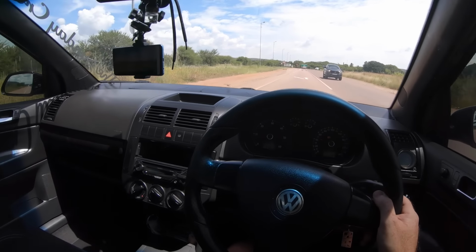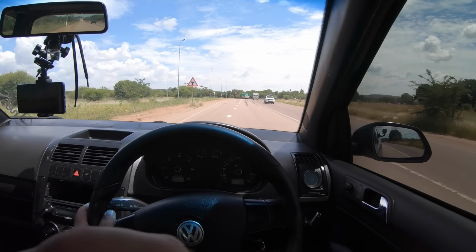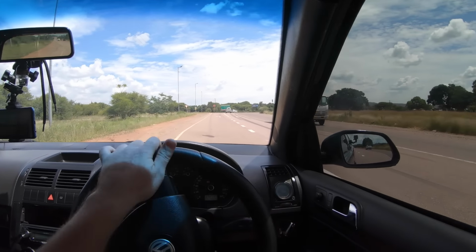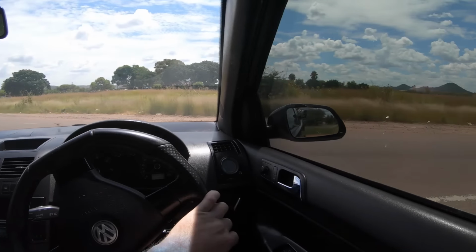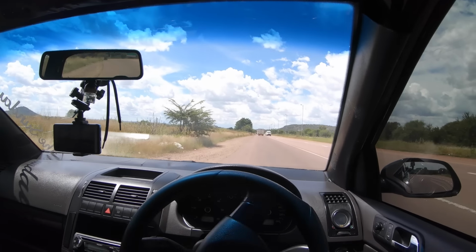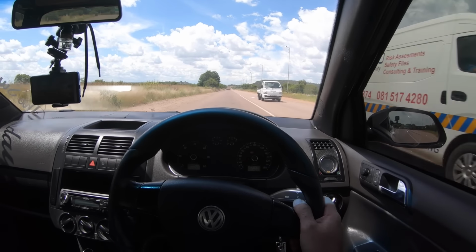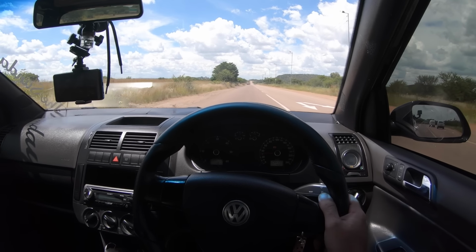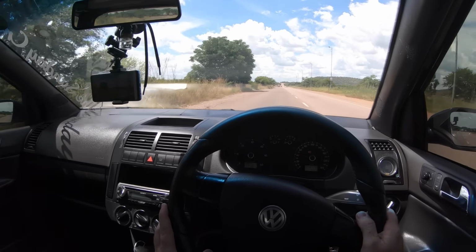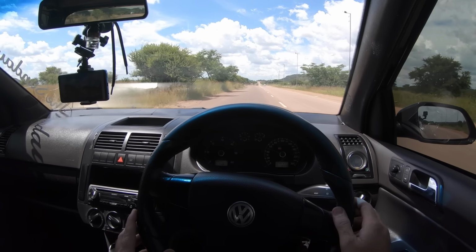I missed third gear on that run, but our 60 foot was quite good. So you'll see with these tires, we spin the car. First gear, we spin it off the line, and then second gear, it almost dead hooks. So yeah, not too concerned about the first gear wheel spin, but second gear it definitely hooks, and the tires are gonna get warmer as we do one or two more pulls. I have to do more since I slipped third gear. So let's do this again.